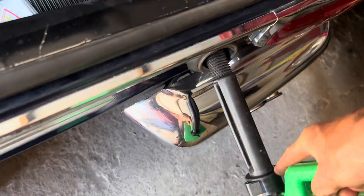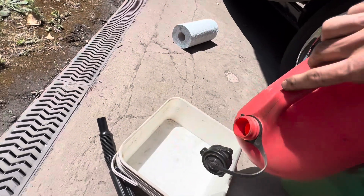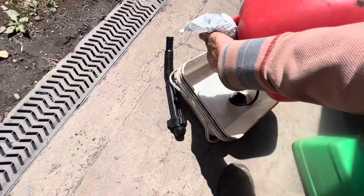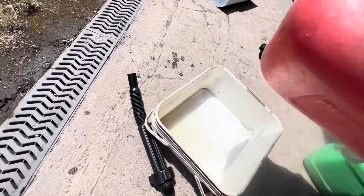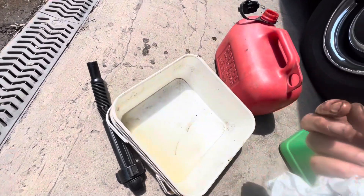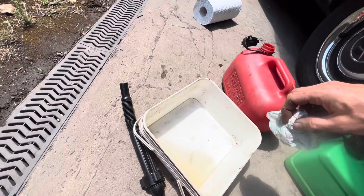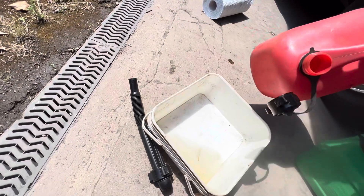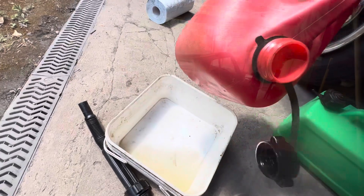I won't know if we've fixed the leak properly until we fill it up, so we'll fill it with some small canisters and take the car to the garage for proper fuel. Looking at the small dribble of fuel that came out, you can see little pieces of debris in there, so it's probably time we changed the fuel filter — the strainer I should say — and possibly even renewed the fuel tank, as there are still some little black pieces visible.